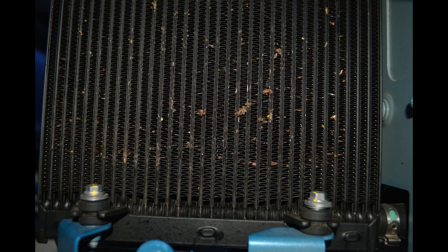That's what the side radiators look like after you've given them a vacuum and a brush with a stiff nylon brush — as you can see there's still a bit of crud stuck to them. You need to wash them out as well. Don't forget these radiators are at temperature when you're driving, so these bugs are potentially being cooked into your radiators. It's a right pain — you need to soak everything to get it soft and mushy, then use a bit of pressure washing or a stiff brush or one of those air conditioning fin brush tools.